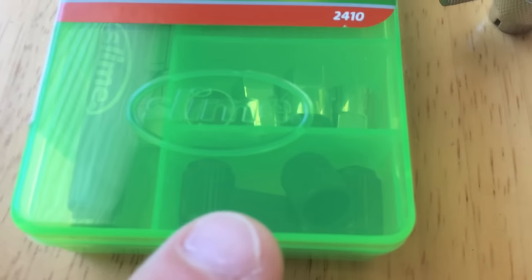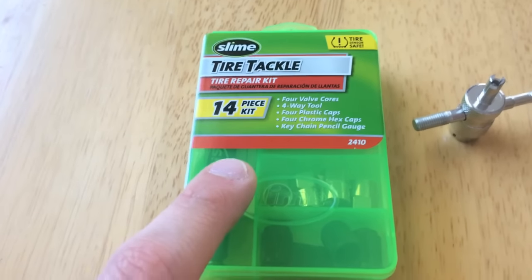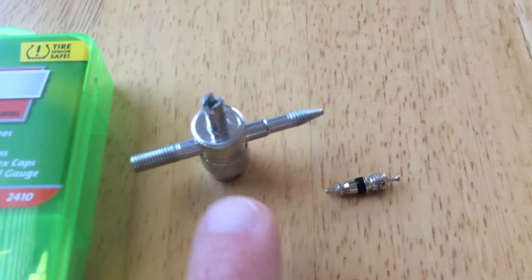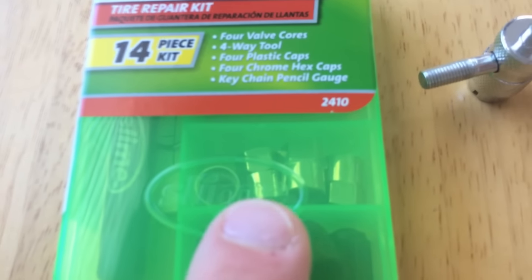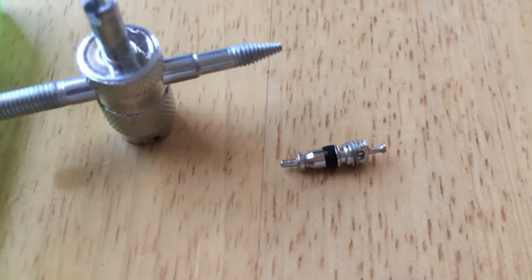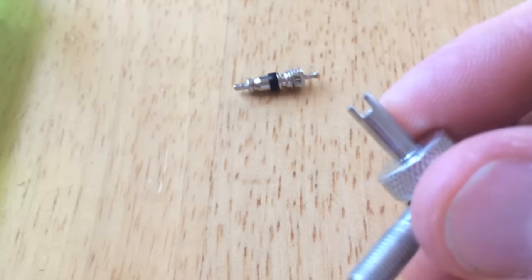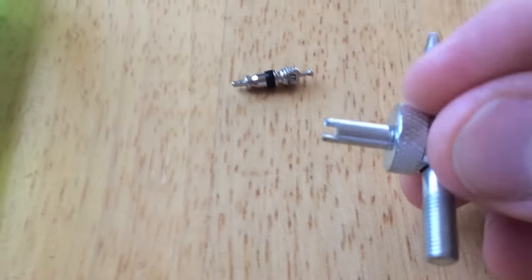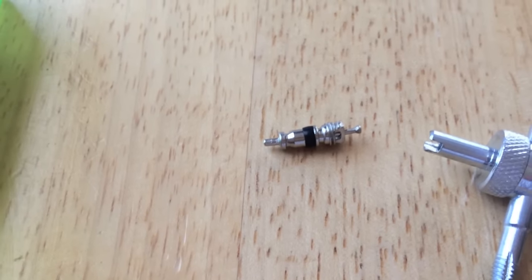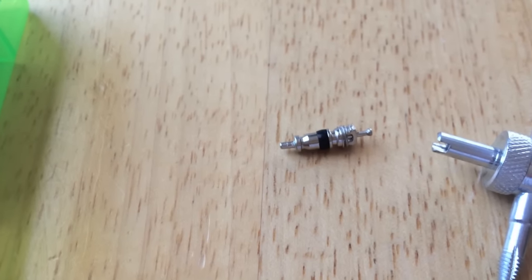When you take off this little plastic cover, I bought a tire tackle kit which was $4.99. It comes with four of these Schrader valves, a four-way tool, four plastic caps, four chrome hex caps, and a small little tire gauge. You're going to use this little four-way tool — you've got that little groove right there and you just pop that inside, slowly and carefully twist to the left until you can pull that piece out. That is the new piece and we'll show you the old piece later when we get to the car.